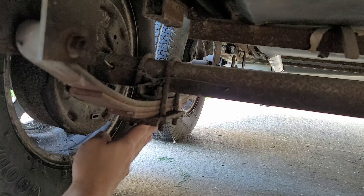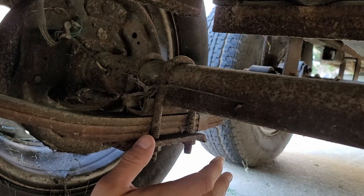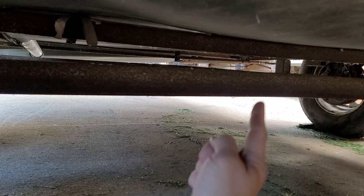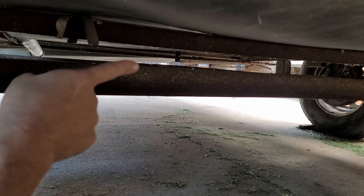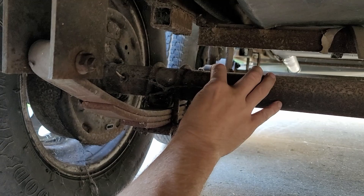But what you have to do is your spring perch is on the wrong side of your axle. So what I did is I bought new leaf spring perches and I'm going to weld those to the top of the axle. Whatever you do, if you do an axle flip on a trailer, do not just literally flip your axle around. There is a bend in your trailer axle tube — it's bent up like an arch, and that helps when the axle bends under load to put the right camber on your tires. So if you were just to flip the whole axle, the bend would go the wrong way and it would wear your tires wrong. Your brakes would be upside down. Don't just flip your axle by rotating it — you actually have to keep it stationary and drop it underneath and then put a new perch on it.